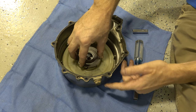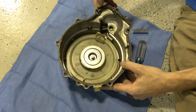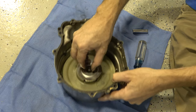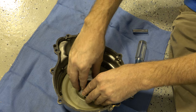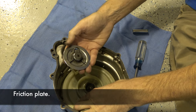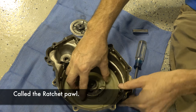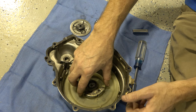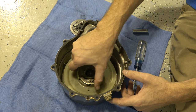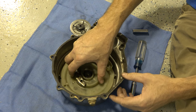All I need to do on mine is replace the pull rope and the handle. The gasket's not the best but I'm going to live with it. You have one bolt holding this all together. When you take this bolt out, keep some pressure on the plastic wheel. Underneath is a coil spring and that's what makes your rope rewind. If you can free spin it either your spring is toast or it just came off track — turn it counterclockwise and if it returns then that's not your problem.